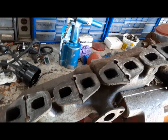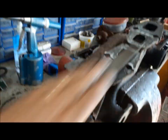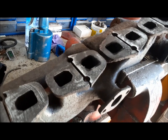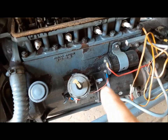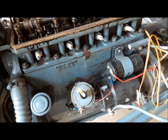What I'm going to do now — a fast check for the manifold is you just grab a file and run it up and down and see what it touches and doesn't touch. This one to me seems pretty good. You can also put a straight edge across it and start with a one-and-a-half thou feeler gauge, but this I'm pretty sure is close enough to seal up. I'm going to go over the ignition and make sure everything there is good and how it should be.